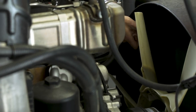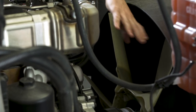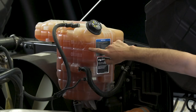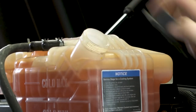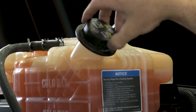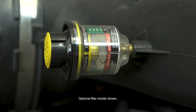Visually inspect fan blades for chips or cracks. If any issues are found, contact your maintenance provider. The 2.5 gallon washer bottle is located here. With the engine cold, confirm that the coolant level is between the min-max lines. If coolant is low, review the vehicle operator manual to identify the proper coolant to add. Unscrew the cap and slowly add coolant until the level is between the min-max lines. Tighten the cap. Check the optional air filter minder. When the gauge is red, contact your maintenance provider.